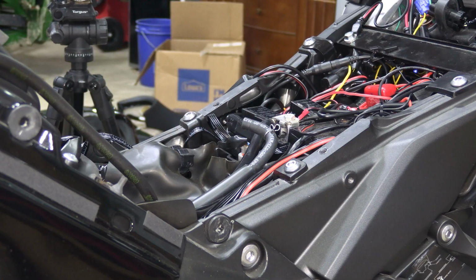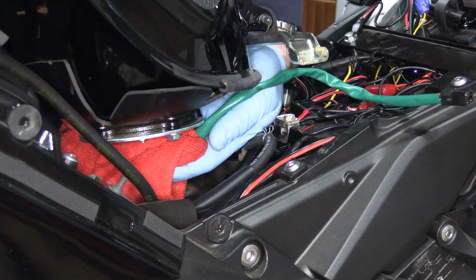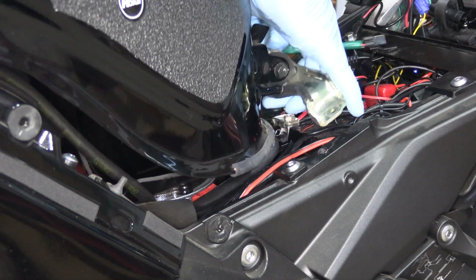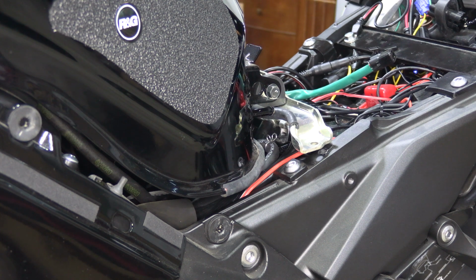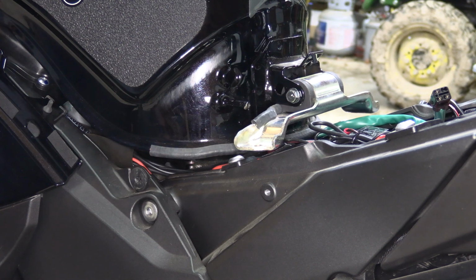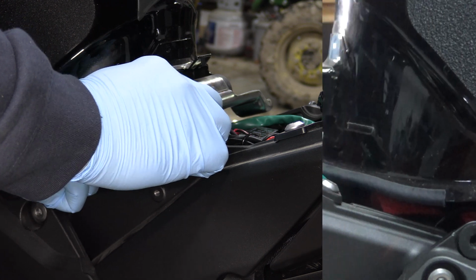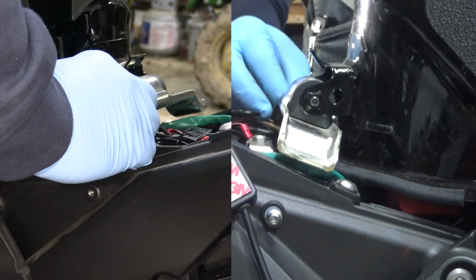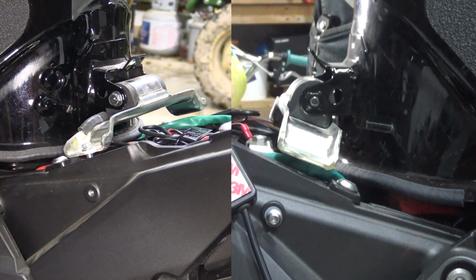Okay, now to reinstall your gas tank, you want to carefully bring it over, just kind of line it up, you set it down. I find it is easiest to go ahead and put the 2 bolts in the back piece. Remember, that's your 8mm socket, and make sure you're not pinching anything or crimped on anything. You just want to start the bolts. Because right now the hose line's in the way and we are hooked up. But this will allow us to just lift the tank.